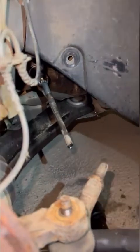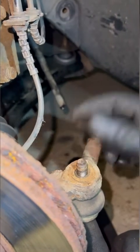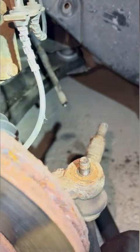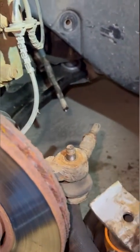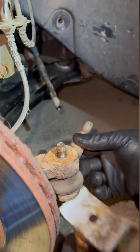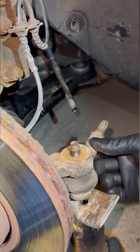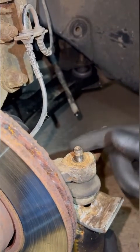What you'll find on your car is it'll be one piece. Here's a quick top tip: this boot - when you've got to take the nut off, it sometimes will spin. What to do is put an axle stand underneath it. The car needs to be higher than it is now, but you pull the pin out, put the stand there, and lower the car so it sits onto the stand. Then just loosen the top off - as long as there's pressure on it, it'll stop it from spinning.